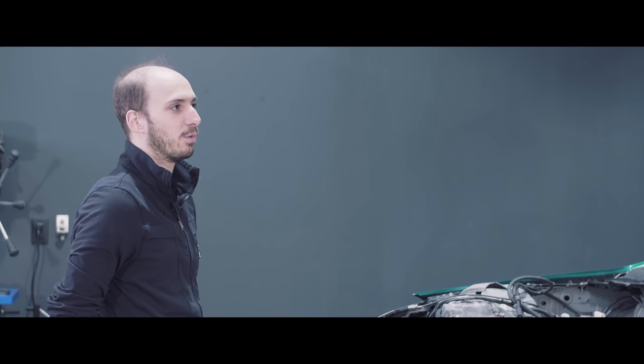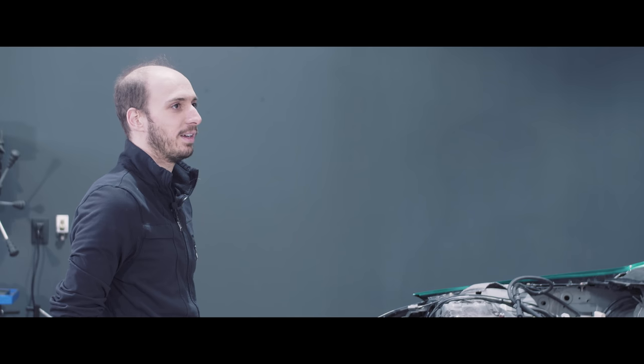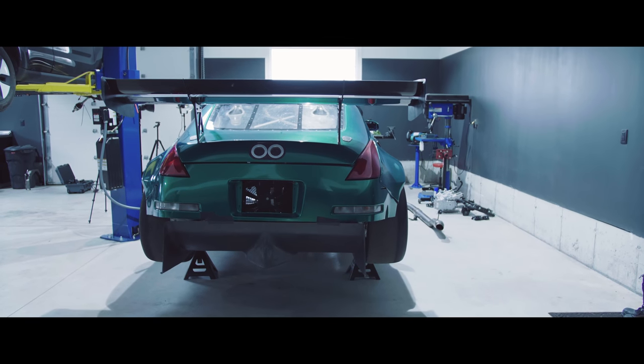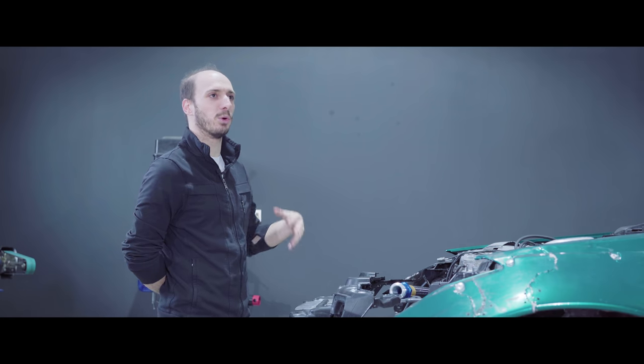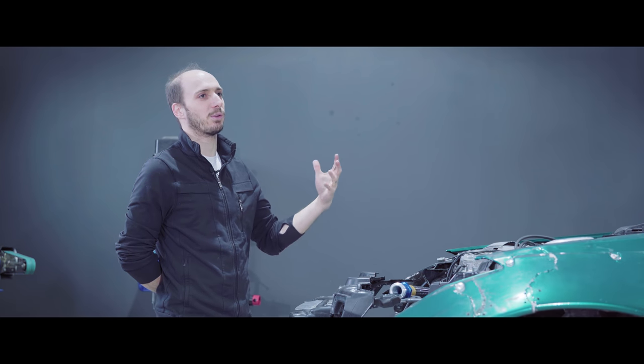We're hoping to be over 450 horsepower or so, but we're going to be closer to 500. And on top of that, we're also going to be adding a hybrid system. We'll actually have upwards of 650 horsepower at the wheels for time attack for a couple of laps. The hybrid system will work as a KERS system where it recovers energy during braking and then redeploys it when you accelerate out of the corner.